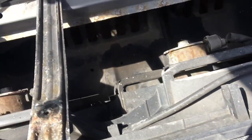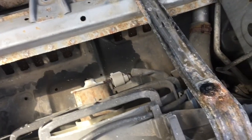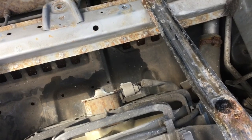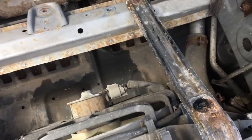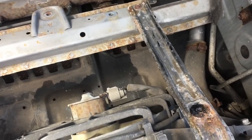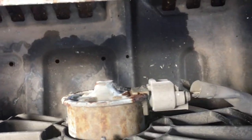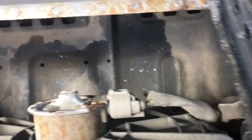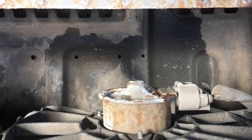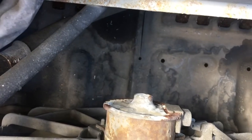I had a look around. I didn't know what 'near side' means — that's not terminology in New Zealand. It means the side of the vehicle parked closest to the curb. On a British right-hand drive vehicle, that means the left side of the car. And sure enough, we have these patches coming from the near side of the radiator. There's no way to tell how old or new those are — maybe they've been there for years — but they don't exist on the driver's side.